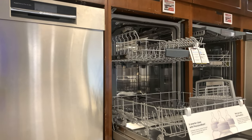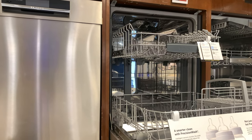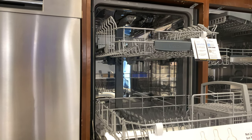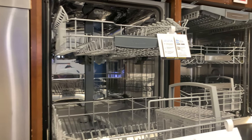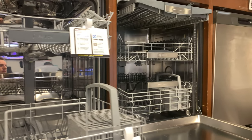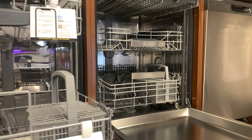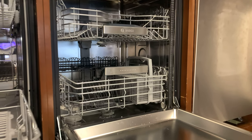One of the most important features of Bosch dishwashers is that as European models, they don't have heating elements. Instead, they utilize condensation dry. The last cycle uses very hot water, and the condensation is then wicked to the stainless steel tub walls. Heating elements are most common in American models, but these are only marginally better since they cause the excess water to evaporate in a similar fashion.